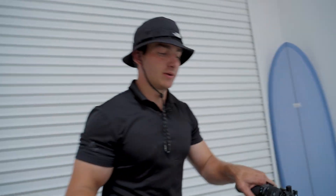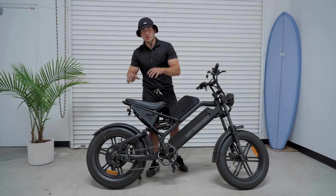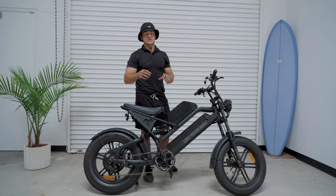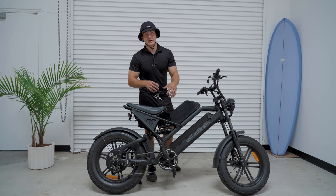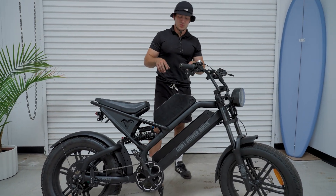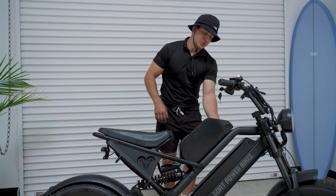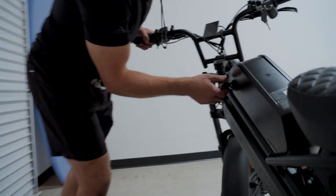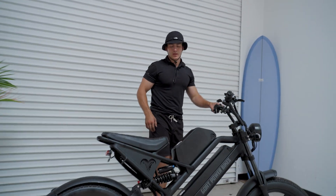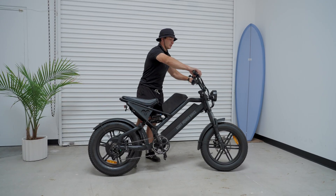Here's an overview of how everything works with the dual battery system. The battery balancer takes the connection from one battery and turns it into two, so they will sync together and drain in sync — it's not just one battery draining, it will be both draining at the same time. Another thing to be aware of when attaching the new battery: just make sure you hear that click after you slide it in and that the key turns all the way. There's a directional for the key, and once you hear that click you'll know it's on. The battery balancer takes power from both batteries so they drain equally, which means you'll get better range with the dual battery setup.